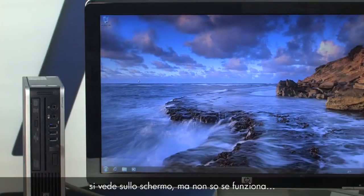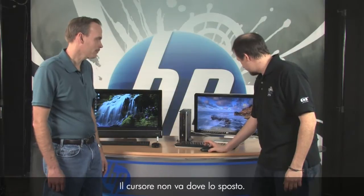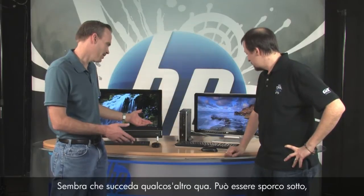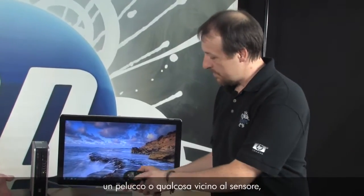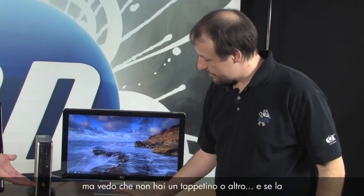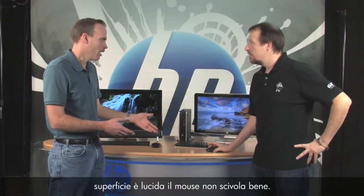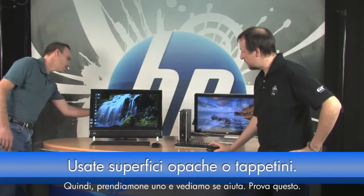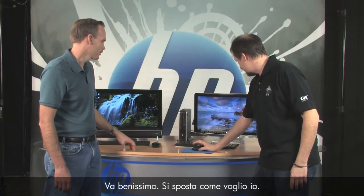We're back on — it's moving now, but it doesn't look like it's tracking too well. It's not sticking with where I'm moving. Things in the environment can cause that — fluorescent lights, cell phones, even speakers — but typically that's intermittent. It might also be dirty underneath around the light sensor area. Also, your surface being glossy can cause poor tracking. You want a nice flat matte surface. Let's get your mouse pad — try that. Hey, smooth as butter! It feels very good, moving exactly as expected.